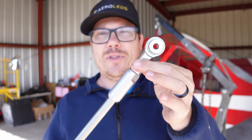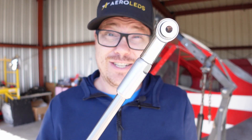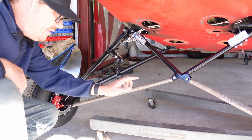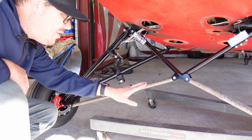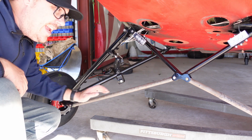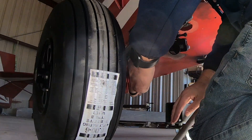Once installed, you want to take a three-quarter inch wrench here and here, and tighten this to make sure it is secure. The first step is to remove the temporary piece of metal — and for you guys, that would probably be a bungee or some other suspension system you're currently using. You would just undo the nuts on the back side and remove the bolts. Simple.